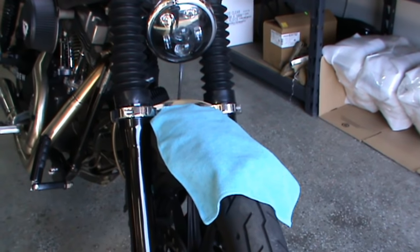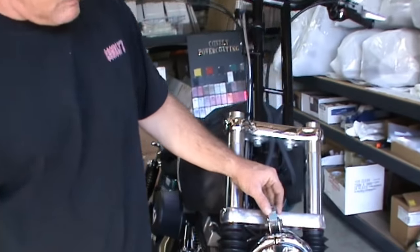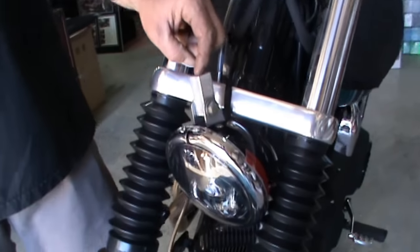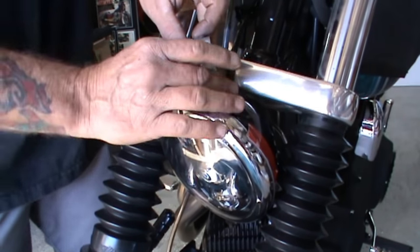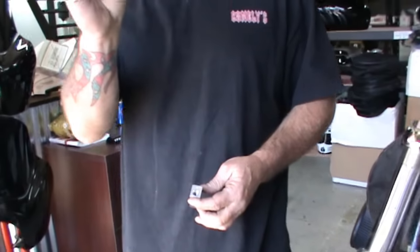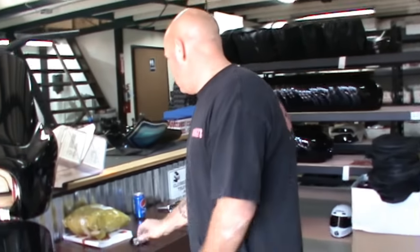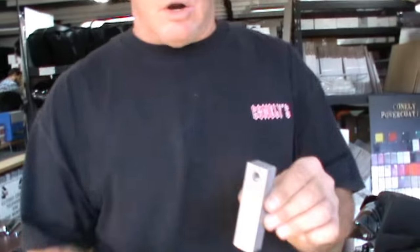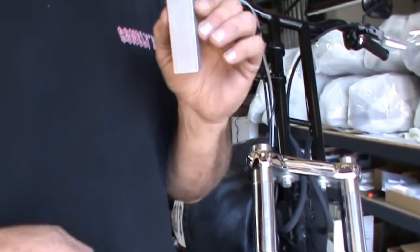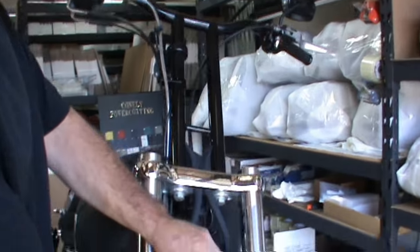So here we have the covers that you would require. Moving into that, your headlight is going to look like this. Take the bolt out of your headlight — keep the bolt, don't lose this bolt. Get rid of the other part. At that time, our kit provides a headlight relocation block. Put that onto the headlight.